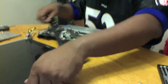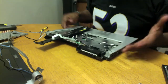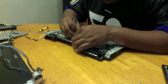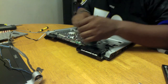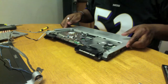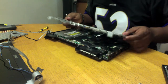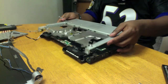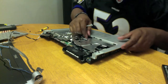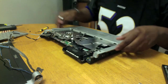Alright. Now I've gotten that taken care of. Bada bing, bada boom. There's one more little attachment here. This one actually controls the hotkeys on this display panel. So I just took those out. And that's a whole another section. Now that I've removed all of those, this is almost disconnected. It's only connected by one little wire, and the wire comes apart right there. I got one more for my actual touchpad. All these are basically, you pull them out and then pull the tab to release.